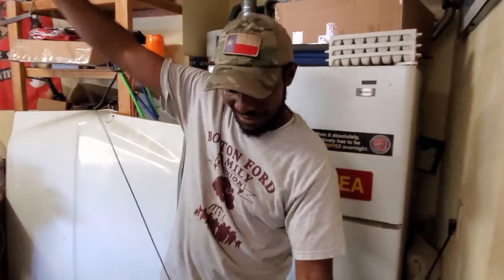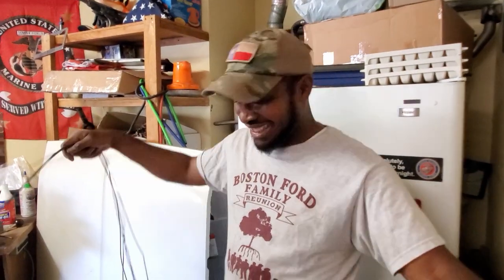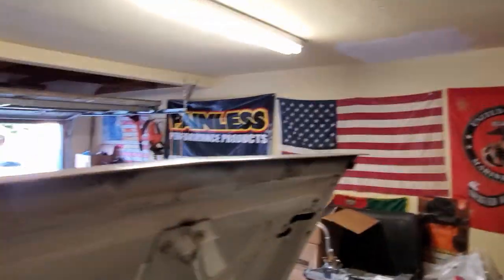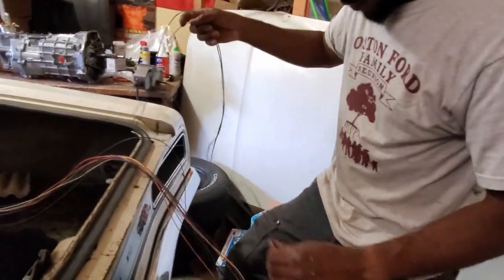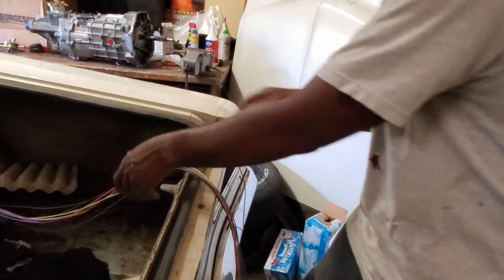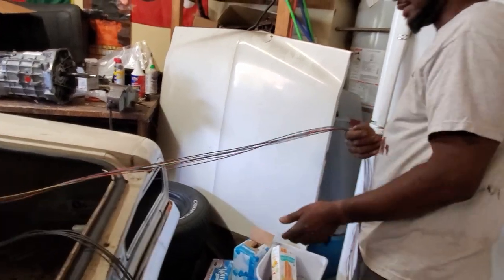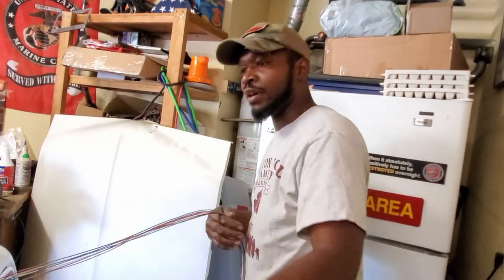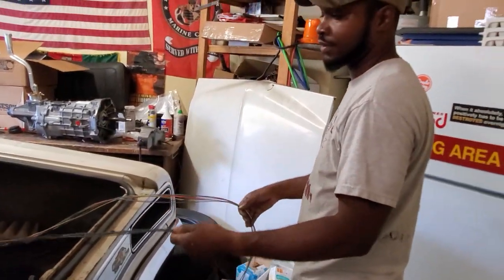It is nice that it is labeled. You said it was Painless - I was like, when do you need this done? Give me 15 minutes. Painless wiring - good stuff. What we're trying to do right now is separate the wiring harness and make it look like something. We're going to separate this and pull right turn signal, right marker light, left turn signal, left marker light, fuel sending unit, and rear license plate light. Once we get all those identified and pull them to location, this one's ready for terminating.